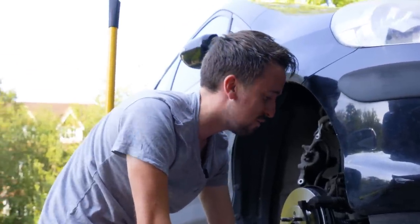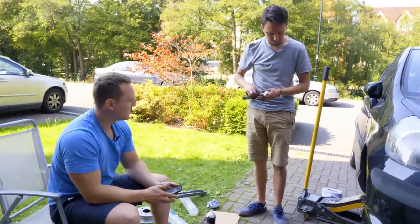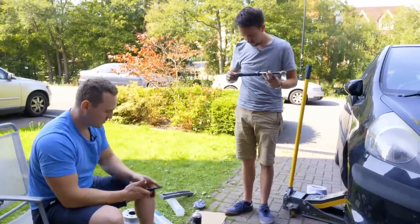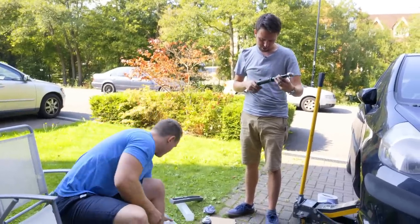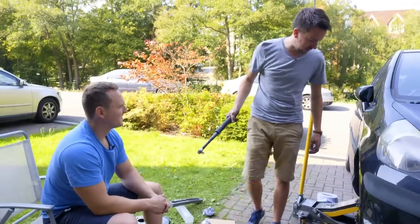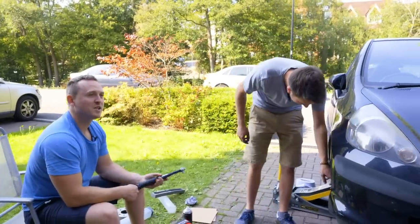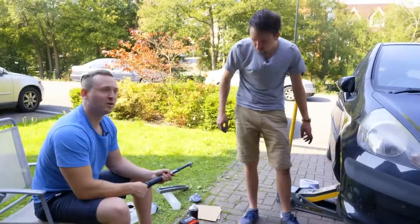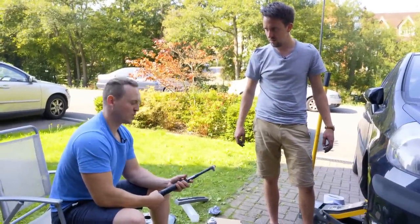Right, so the front carrier bolts, Ethan. 108 newton meters. Just chuck it all about, it's fine. I've seen you and Gareth do this and you twist something. Alex, if you could put 108 newton meters into there, I'm just going to check what's going on here a sec. Well, actually, I can only put 100 in because it only goes up to 100. So we'll go up to 100 and then we'll give it a little twist afterwards.